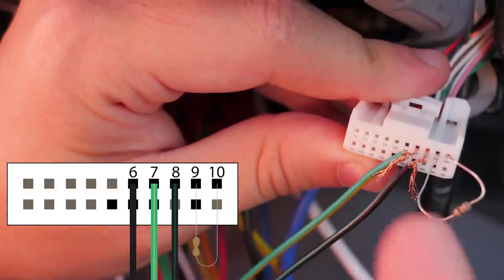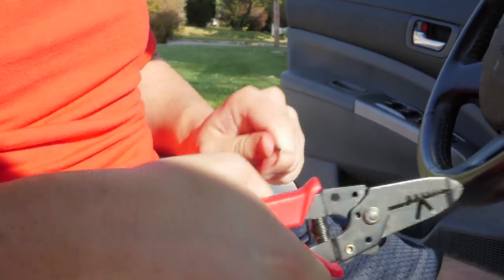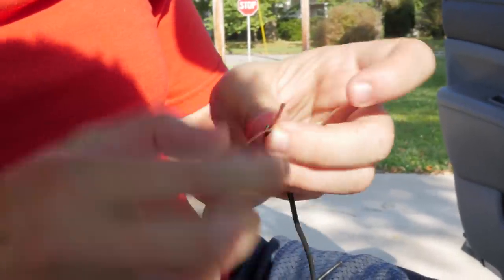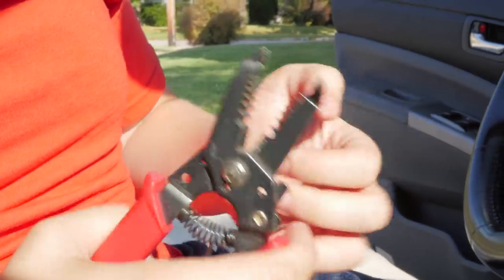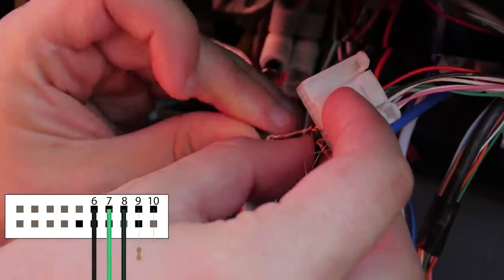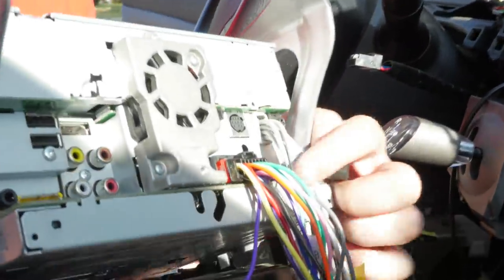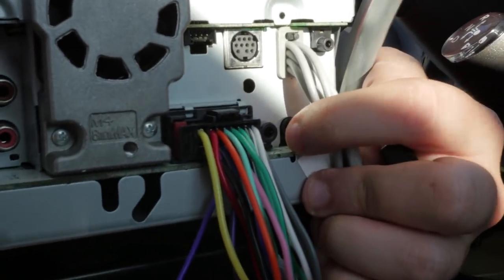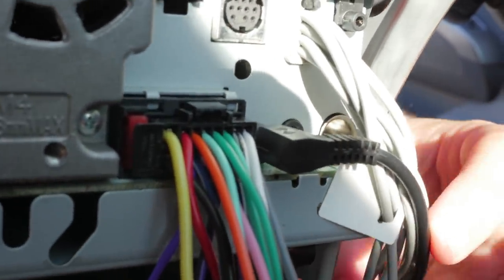I've got some extra black wire here, so I'll cut off some of it. This wire has a lot of extra threads, so I'll take three or four of them, twist off the excess, and cut that away. The other side won't matter too much since we'll be screwing it around the bolt. Now we can take it over to our grounding bolt and tighten it up. And now the black negative wire. The final step is just to plug the interface into the back of the stereo. On mine, I have a W/R port that is wired remote — don't get it mixed up with the aux port because that's for audio, even though they're the exact same jack. Just plug that right in there, and that's how it will receive the steering wheel controls.